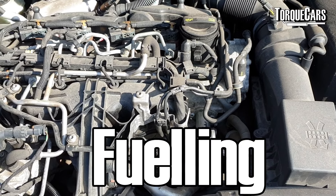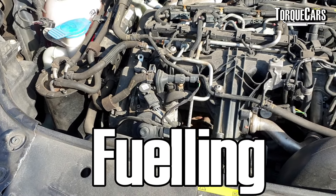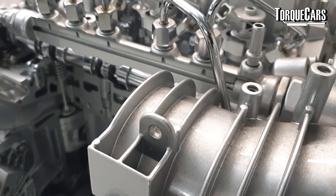If you want more power than a remap alone provides, you need other components upgraded. Fueling often becomes a problem when power is significantly increased — you're burning more fuel, so the engine must get enough fuel to match the incoming air. Look at uprating the fuel pump and injectors; these can often be swapped from higher-performance variants within the Volkswagen Group family. From 2010, the EA189 engines had an upgrade to eight-nozzle injectors, which gave much better fuel atomisation into the cylinders, helping economy and power.